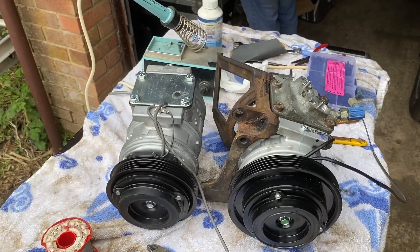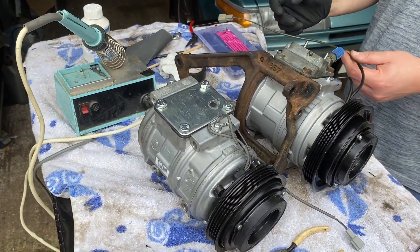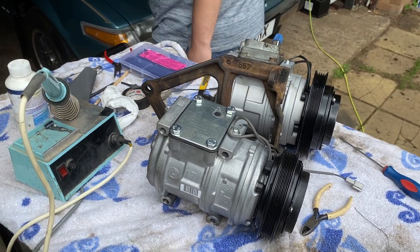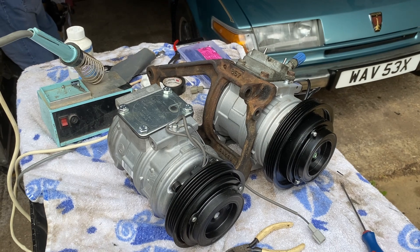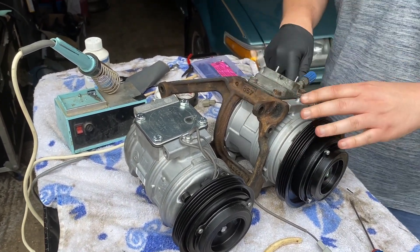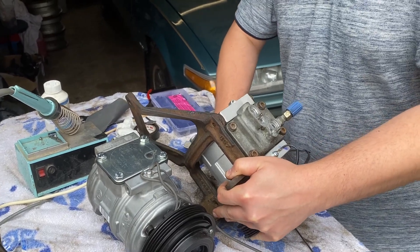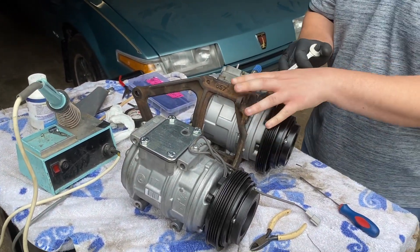Welcome back to part two of the air conditioning compressor change. Smugness didn't last long — it's usually the way. As you can see, we've got two air conditioning compressors on the go, because the one on the left that says A17 on the side — which is listed correctly in all the books and the parts catalogue in the UK as well as where I got it from in the States — doesn't actually fit the car. It looks the same until you get to fitting it, then you realise it sticks out too far. After lots of engineering and looking on the internet, we found that the number on the back — which is 15C — is the correct one, but it doesn't list it for a Supra. It's actually off a 1990 Land Cruiser according to both the American and UK catalogues, but it fits. So there's a little nugget of information: don't always believe parts catalogues because they're not always right.